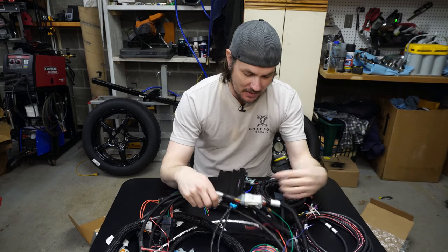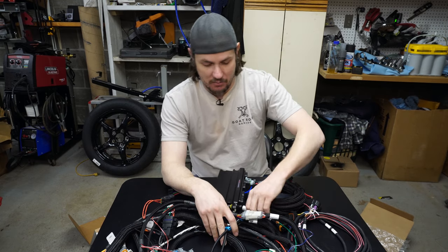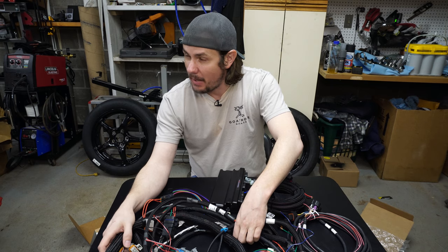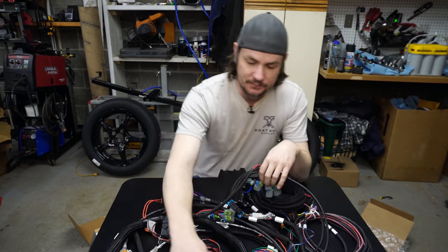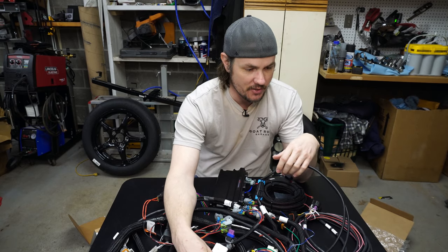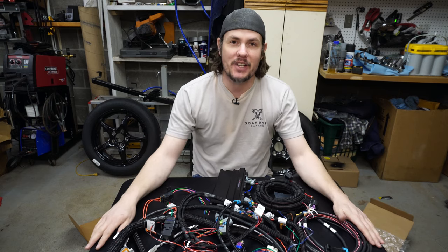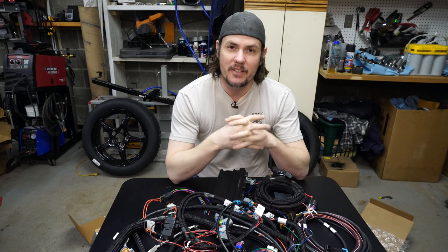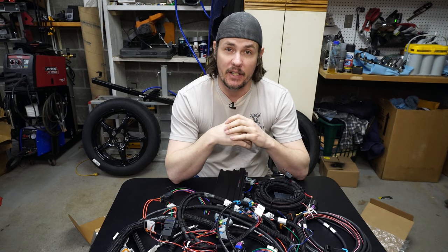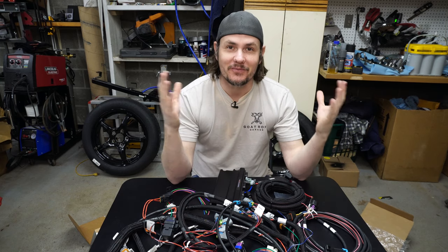A couple I'm worried about are the oil pressure and coolant temperature — the coolant temp is on the back side of the block, oil pressure is on the driver's side, and another sensor on the passenger side. I'll also have to figure out how to make the throttle position and IAC work with this, so I need to do more research there. Stick around as we keep progressing on Project Country Club — I'll be doing a video on relocating the battery to the back, and we'll also have a video soon on the standalone transmission controller. Short but sweet — always be tuning.